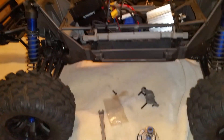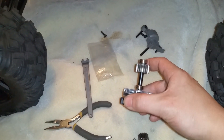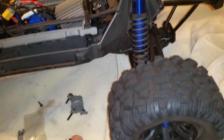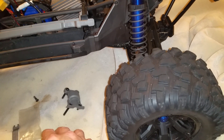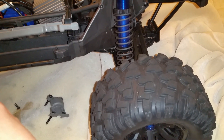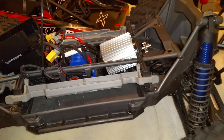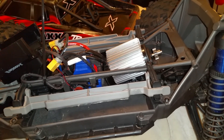For those that don't know what pinion and spur gears do — this is how the gearing of the X-Maxx works. There's also more reduction done at the differentials. To give you the actual complete reduction, I'd have to count all the teeth on every gear including the secondary spur down in there, then divide them all out to give you a complete final drive ratio, because you have to put every gear in sequence.